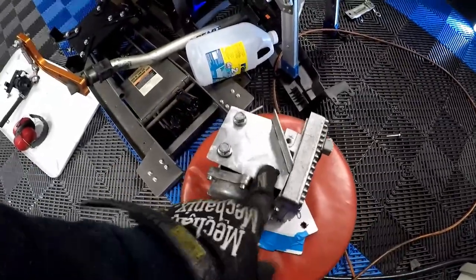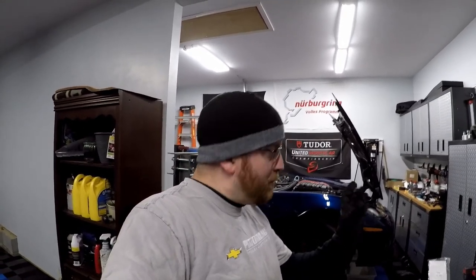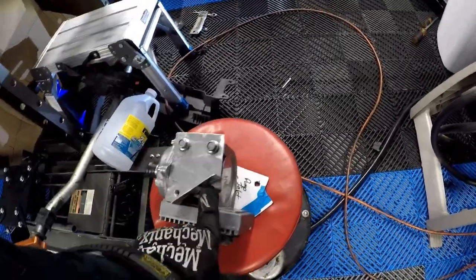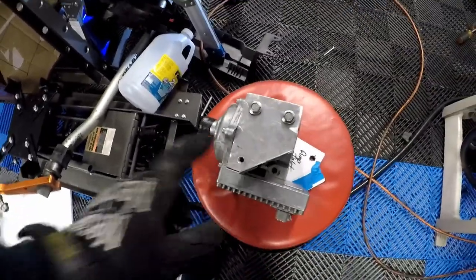We got two holes drilled. The reason I don't have the third hole in here is because what I'm going to do is actually run a bolt through the subframe — I already have a hole there. So all I have to do is line everything up just right and I think I'm going to get a clamping force going sideways with a bolt through the subframe. I may put another bolt through the subframe going the other way, but I'll try what I have right now first.